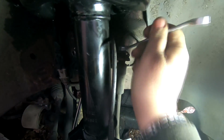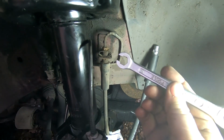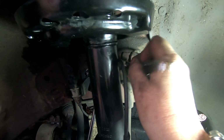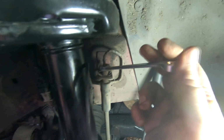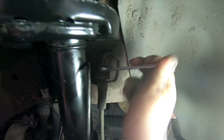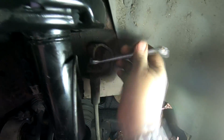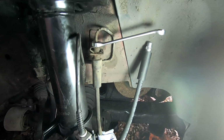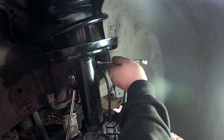What I can show you is I've got one of these 11mm open-ended spanners, especially for things like this, so that can just go in there. As you can see, that goes in there like that, and then I was able to crack this joint, so now that joint is nice and loose. And now I can withdraw that pipe, as I will do, and connect the other one up, take that clip off. And that's what I'm going to do now.